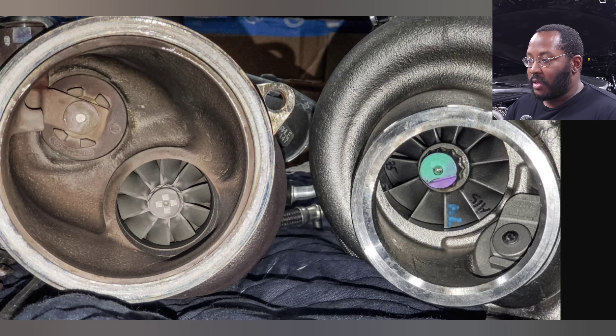The whole purpose of that wastegate flap is to bleed off extra exhaust gases. As you're making a lot of power and flowing a lot of air through your engine, you need that flap to be able to get rid of all the extra gases to control boost effectively. If it's wide open and still not bleeding off enough exhaust gas, you can run into boost creep, where boost will continue to rise and go out of control even though the wastegate's wide open.